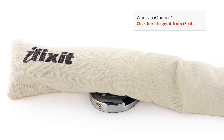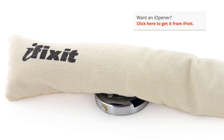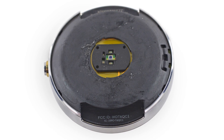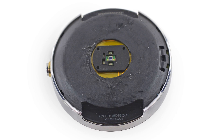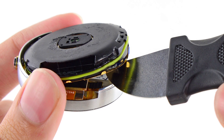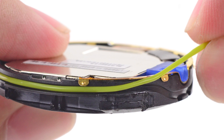Now we are left with our large watch face and we get to work on opening it. That means heat and lots of it. This seal is great for keeping out dust and water, but not so great for quick and easy repairs. Even with the back cover off, we still don't have a clear view of the inside, so we keep digging. With the help of our Jimmy prying tool, we're able to separate the guts of the watch from the LCD. This bright green gasket you see is what helps the Moto 360 achieve its IP67 water-resistant status.